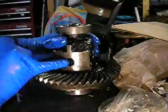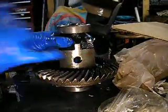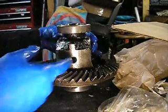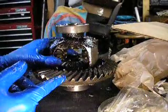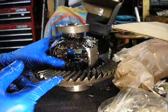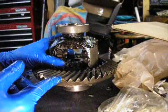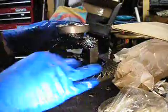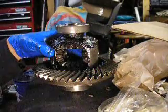So that will take a little bit of lining that up. And again on this one you can see how that washer is out of place. So we'll have to push that around a little bit until it gets into the right place. So that is how you replace your shims behind your differential gears. This particular housing is a 1955 MG TF-1500 differential, but it's very similar to many other differentials. That's it!